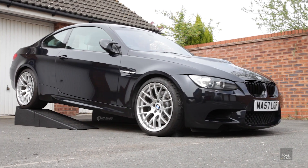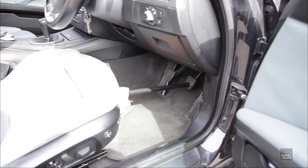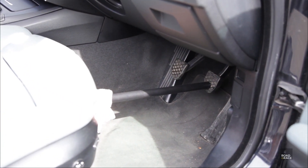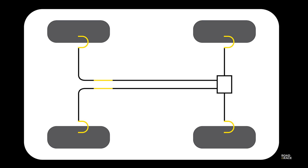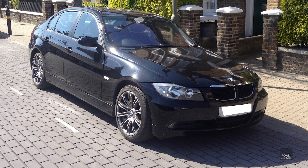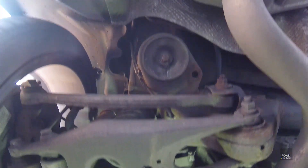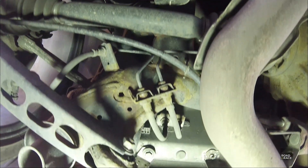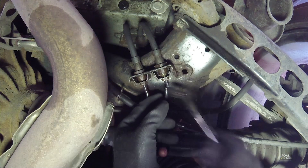After making sure I could get all the wheel bolts off, I hand tightened them back up and put the rear of the car on ramps. My top tip when planning to remove brake lines is to wedge the brake pedal down, as this massively reduces the amount of brake fluid that comes out. Unlike the Boxster which had 4 brake hoses, the M3 has 6 — one for each wheel plus two under the car that connect the rear hard lines together. Many years ago I replaced brake hoses on my old BMW 320d and sheared the brake lines trying to get them off, so starting at the rear of the car is good practice as the hard lines there are quite short and cheap and easy to replace. I thought it was all going well as I couldn't see the line twisting as I undid the nut.